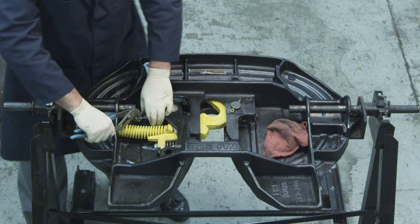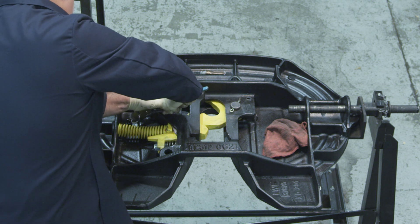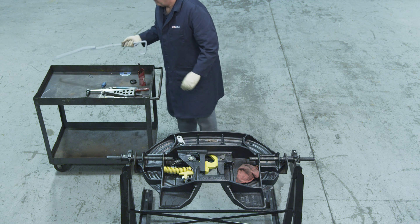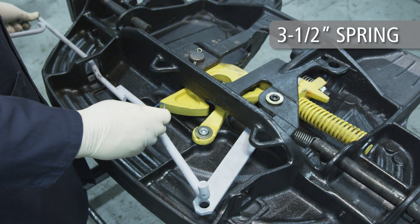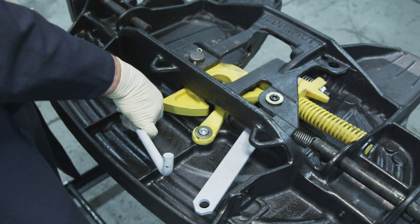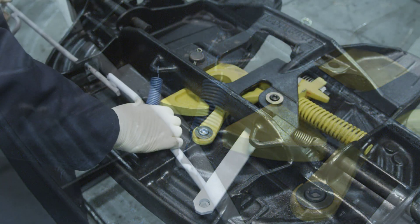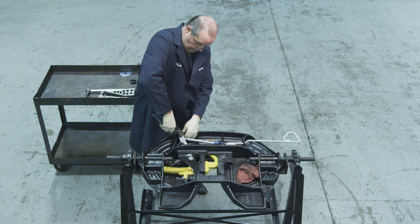Now attach the release arm spring. On older model top plates, attach the release arm spring to the bolt through the casting. For newer models, attach the release arm spring to the cast eyelet as shown. To install the left-hand release handle and spring, slide the handle through the driver side release handle window. Install the three-and-a-half-inch long spring on the handle. Slide the spring around the handle towards the loop retainer, rotate the spring so the loop opening is aligned with the loop retainer, then rotate the spring to engage the spring end in the loop retainer. Hook the spring through the casting lug and the handle end through the hole in the end of the release arm. Place the washer over the end of the release handle, secure the handle using the cotter pin, and spread the cotter pin.